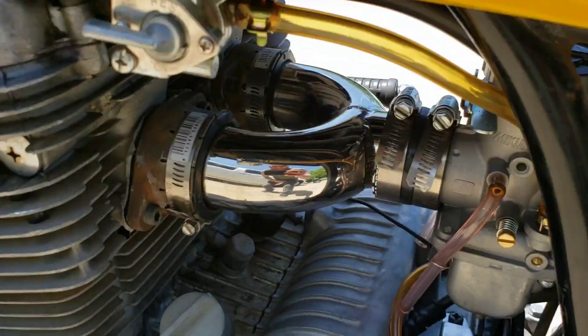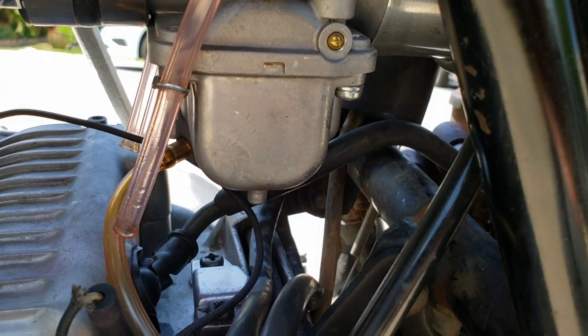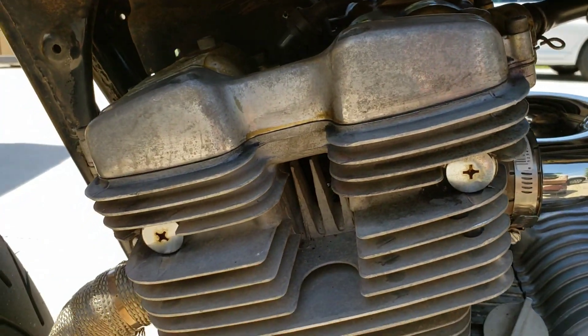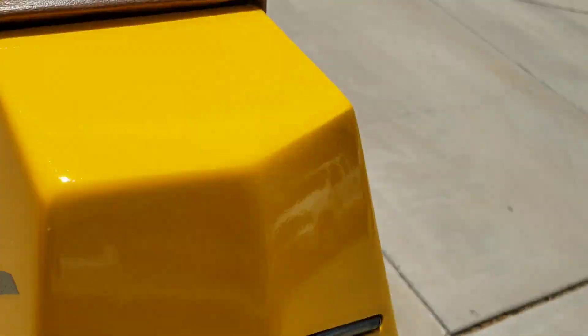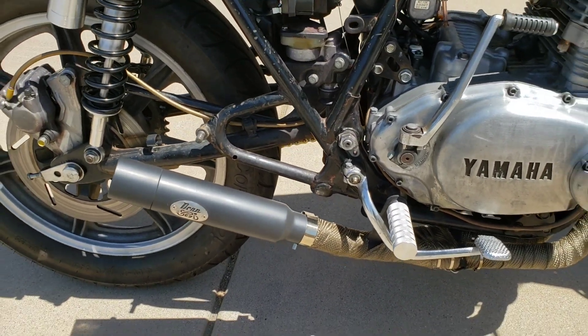Single round slide — that's a VM-36 on a 2-in-1 manifold. Blocked off the tachometer. Did a 2-in-1 exhaust, wrapped it, ceramic-painted, with a single Dean Speed Customs Havoc muffler. The thing sounds ridiculous.